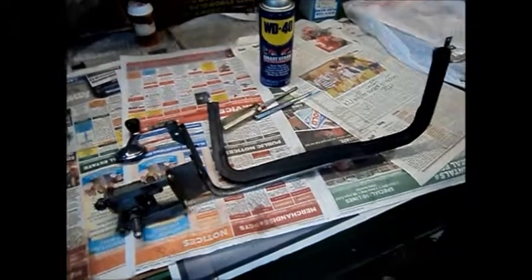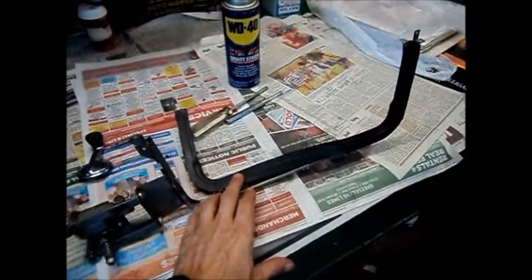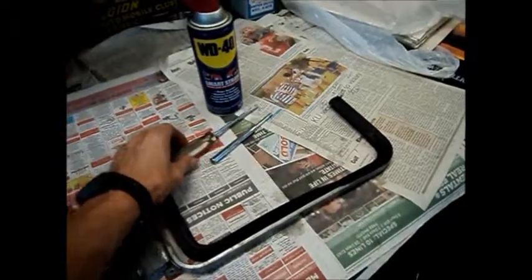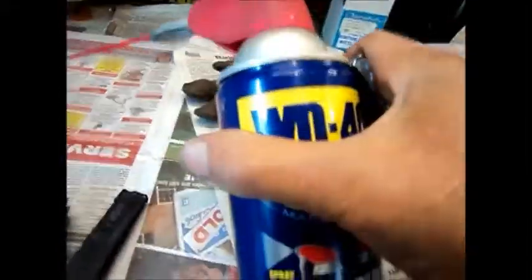Okay, I'm installing the new rubber channel to the wing vent. The gasket, actually, channel is not the correct term. And I'm using a lubricant and some dull tools. This is not a screwdriver, this is a rounded off tool that I use for things like this. And this is just a flat end punch that I make sure I don't have a sharp edge on it. Start by holding it up like this and putting the punch into that slot and pressing down on that center slot. That way, and have it well lubricated in there, with your WD-40.